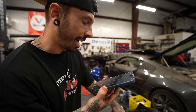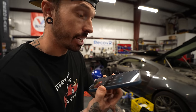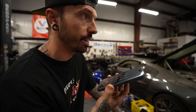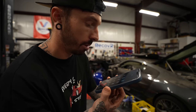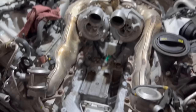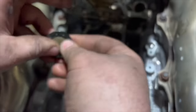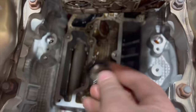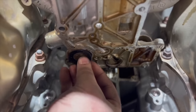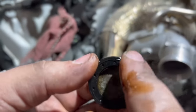Hello, I've got an Audi RS7 here, and I believe the RS7 had a recall at some point. And I'm just wondering whether, if I give you the VIN number, you'll be able to see whether the Audi's had the recall on this filter, if that's possible. I'm trying to work out whether the oil gauze in the turbo oil feed has been changed. This was a recall on all the RS6 engines, which we didn't manage to get done on ours. And last thing I want to do is put this engine in without doing the job, because it'd be much easier to do with the engine out.